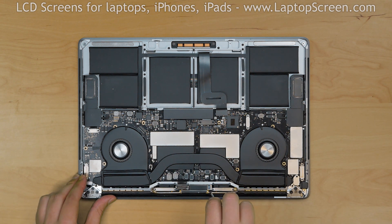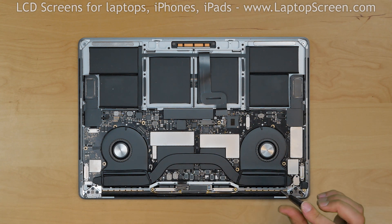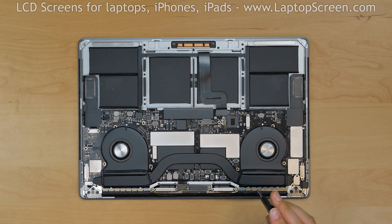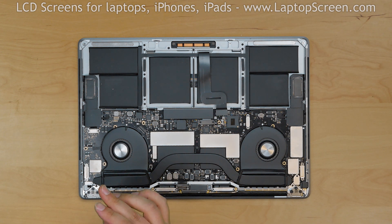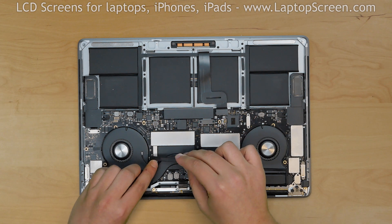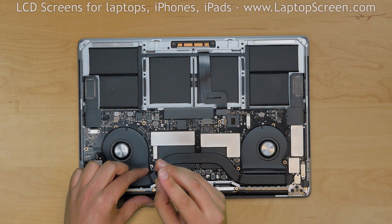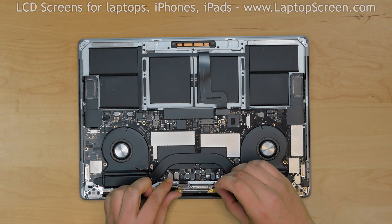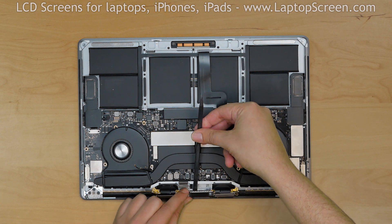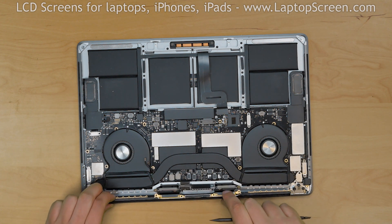Using a Torx 5 screwdriver, remove four screws holding the LCD driver board. Using a Pentalobe 0.8 screwdriver, begin removing screws holding the WiFi antenna assembly on the right side — there are eight screws in total. Proceed on removing the other eight screws on the left side. Using a plastic spudger, disconnect the three coaxial antenna connectors. Using a Torx 5 screwdriver, remove the antenna cable and grounding screw. Gently bend back the LCD driver circuit and carefully pry up the antenna assembly from the center positioning slot, pulling it away by about half an inch.